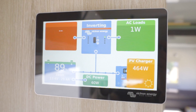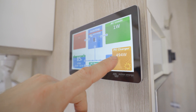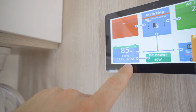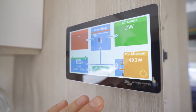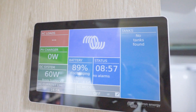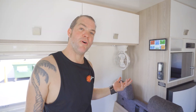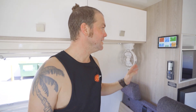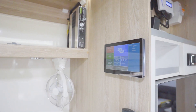The customer can monitor everything here on the Touch 70 panel — slightly bigger. As you can see, it's still the morning and we're getting 490W of solar charging at the moment, which is equivalent to 32A. Sometimes this will actually be more — up to about 650, 680 somewhere — and we'll get 40, 45 amps. Maybe under really good conditions here in Australia, panels even overperform. It's when you go outside and feel the sun burning your skin — you'll sometimes get up to 130, 140 Watts out of a 120W solar panel.